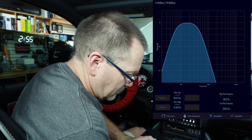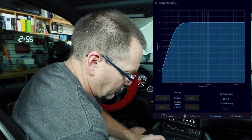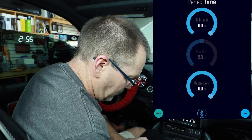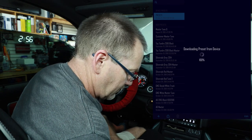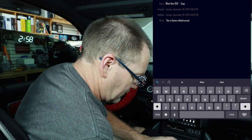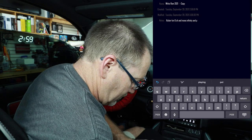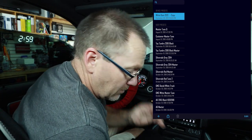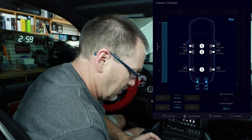These are just preliminary numbers so we have something to work with while tuning. For the rears, high-pass is already set to 80 so we'll leave it and just adjust the crossover to 24 dB. Subwoofers need a low-pass filter — we'll leave that at 80 as well. Then select home, setup, manage presets, the plus icon to create a user preset, download from device, select edit, name it — this is the white Ram — and add notes about what's in the car. Upload to device, select yes. This saves everything we just did onto the device.